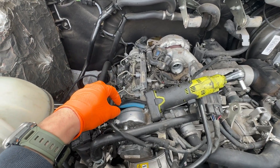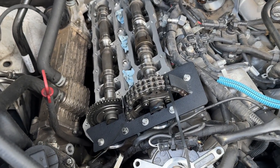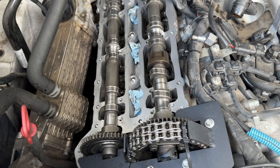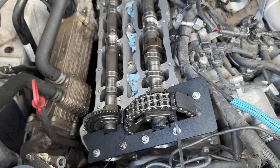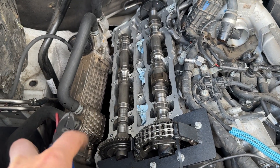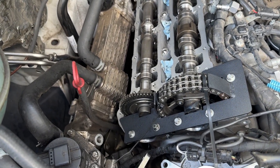To get our chain exposed, we start working on the chain. After removing everything, I'm getting ready to disconnect the old chain. I prefer to clean all the surfaces once I take off the valve cover, getting it ready to put back once the job is complete. One of the parts I don't like in a Sprinter application is taking off the EGR cooler, but you don't have to disconnect it completely — I only disconnect one pipe and put it to the side, then lift it up and secure it with a zip tie.